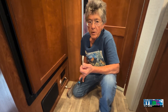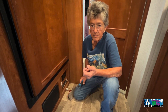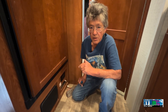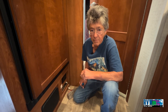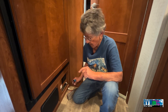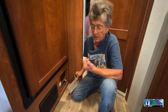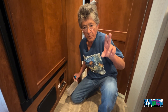If you have an RV that's equipped with propane, you're going to have an LP detector. The purpose of this LP detector is: if it detects a leak, it'll shut the solenoid off to the propane tank, and that'll shut off everything beyond that point. Since propane is heavier than air, the LP detectors are going to be mounted close to the floor and generally close to the gas-fired equipment.